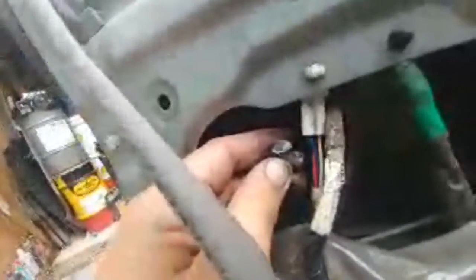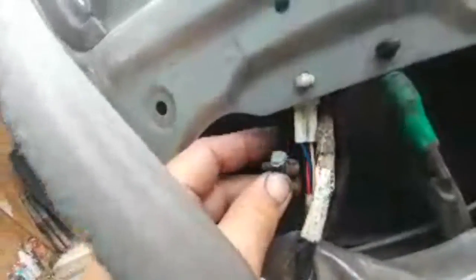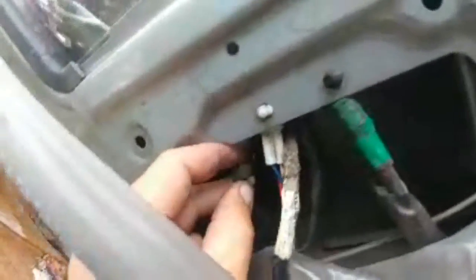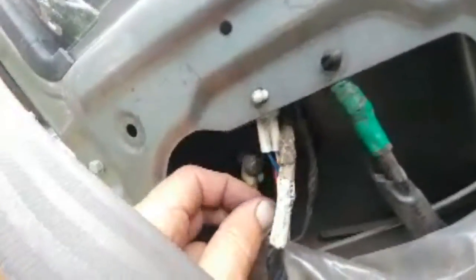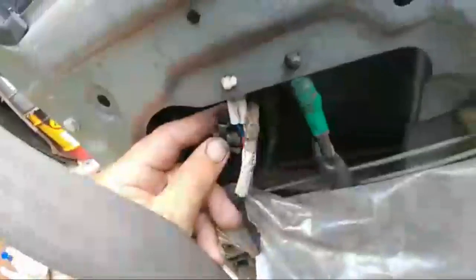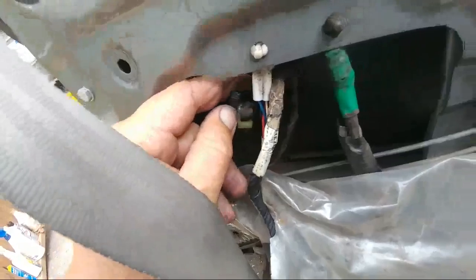this little piece right here, this little black part, it shouldn't be floating around right here where I can show you. And now that I look at the part that's broke, there's not that much material there to be doing the job. Anyway, this thing is hooked to the outside door handle, and when you pull on the door handle, it pushes down on this rod. Broken door handle. And I know I've never been that aggressive with that handle.